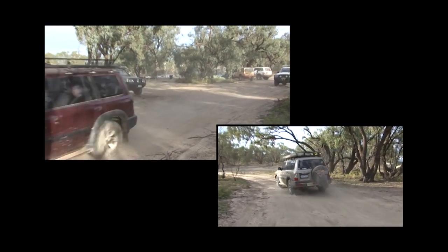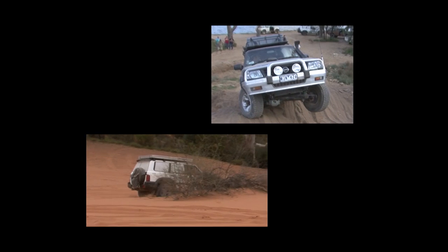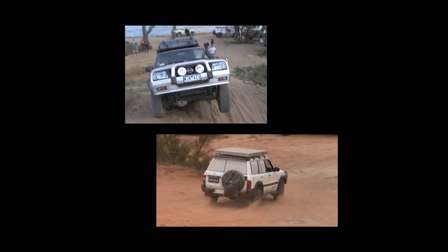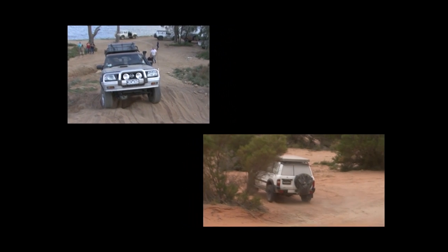The other issue that these do have is heads. The heads are actually really well designed, really well bolted down, which is where the flaw actually starts. Because they are bolted down and because you have a cast iron block and aluminium head, the alloy and the cast actually heat and cool at different temperature rates, causing the head to crack.